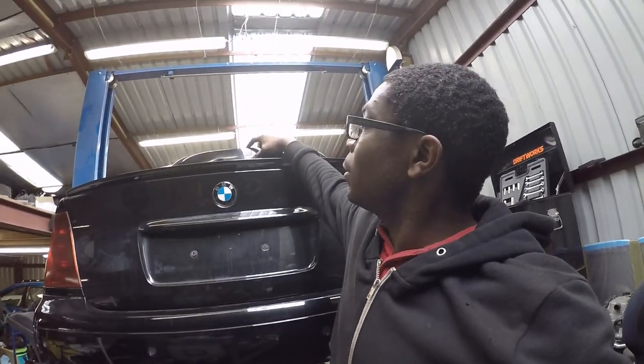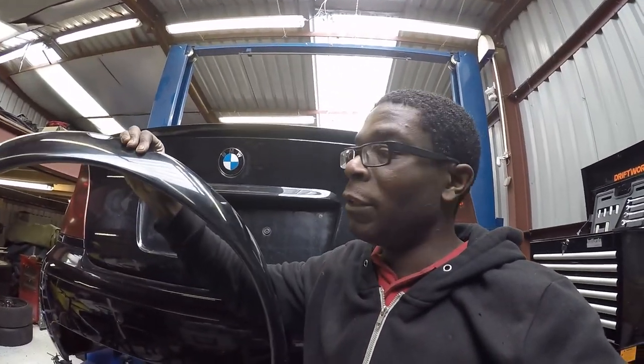Now for a while now I've been a bit unhappy with the way the rear sits. For me it's not quite low enough, so I primarily like to run a 225 45 17 rear tire, and it's an 8.5 wide and I think the ET's 13, so they do stick out quite a bit. So I haven't been able to go low enough simply because it rubs on the arches. So today we're going to fit some of these, which are fender flares.